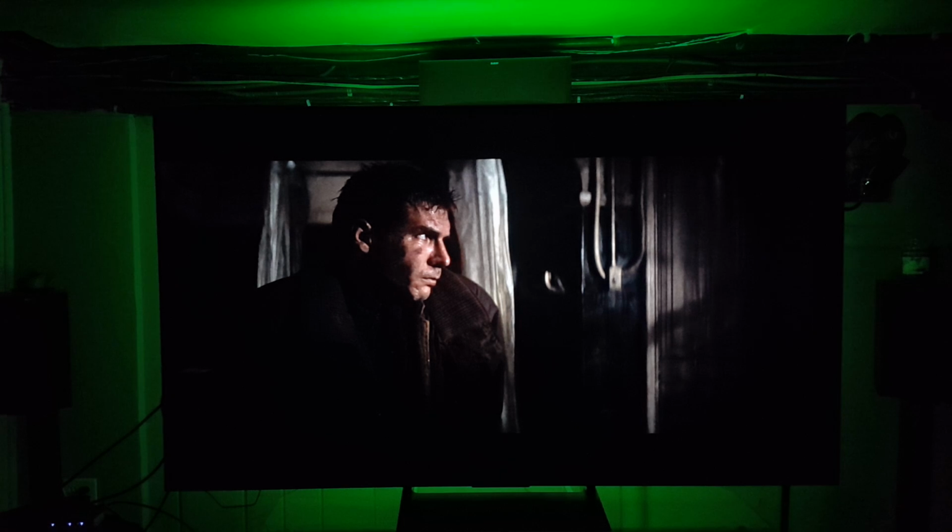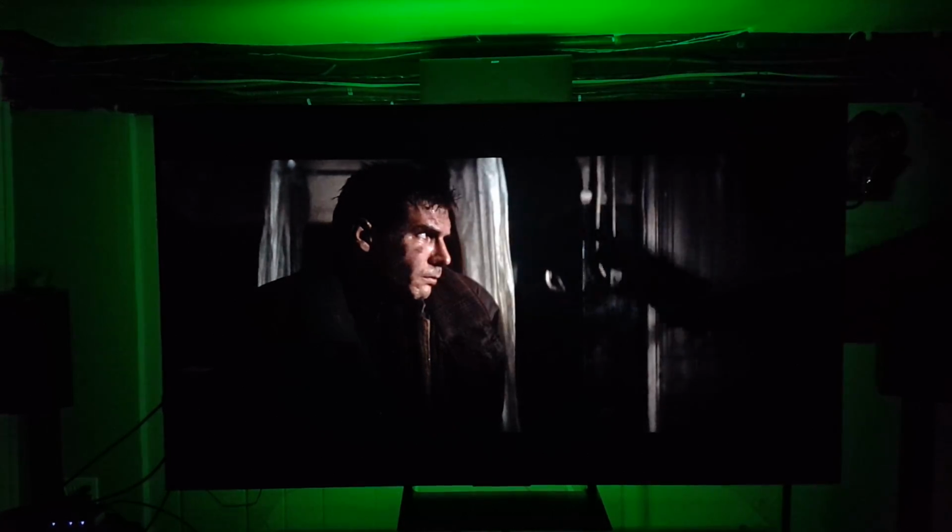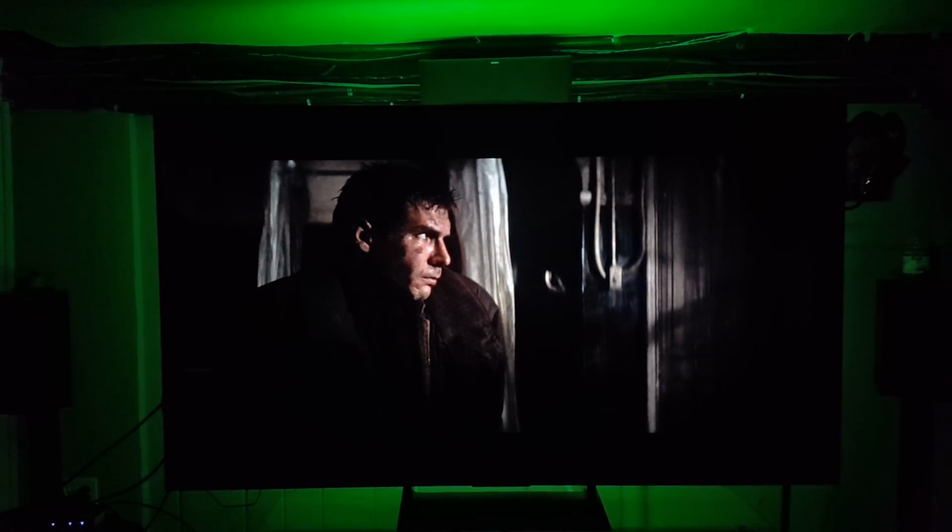But when it comes to flash lighting on the Sony 900E, 940E, 930E, the way you'll be able to tell is uneven black bars, even in calm scenes. So Guardians of the Galaxy, all these bright movies, that's not what I'm saying. I'm saying the way to really see it is on a very plain film. That is flash lighting versus blooming. If you see bright spots in very action-oriented films, that's blooming, and typically that's going to be normal. Especially on the 930E where the luminance is just so high and you're expecting the display to really discern black level from brightness. It's just hard to do if these TVs are so bright now.